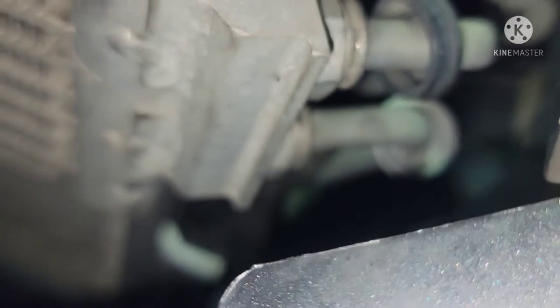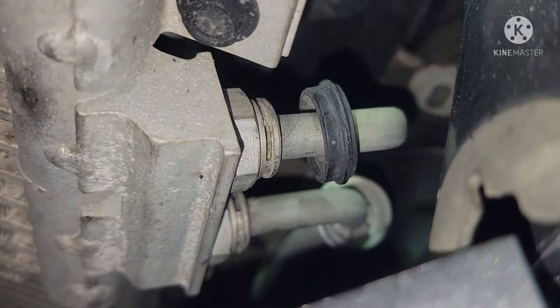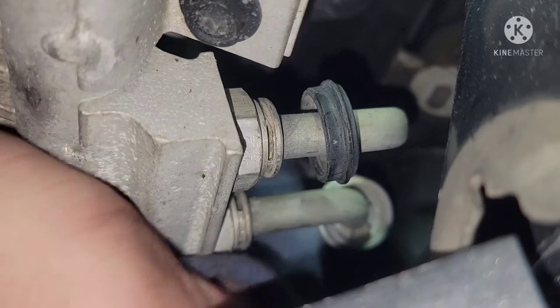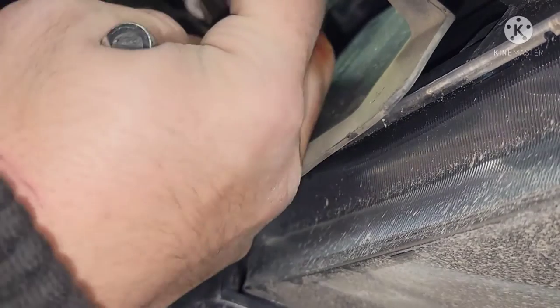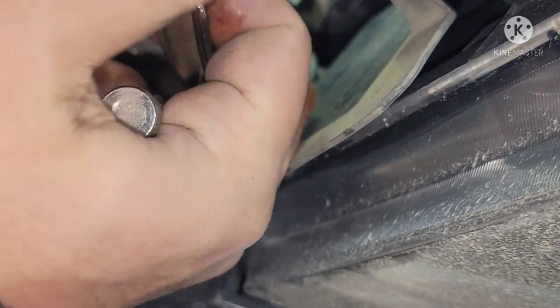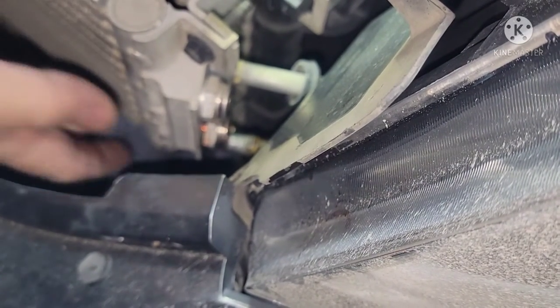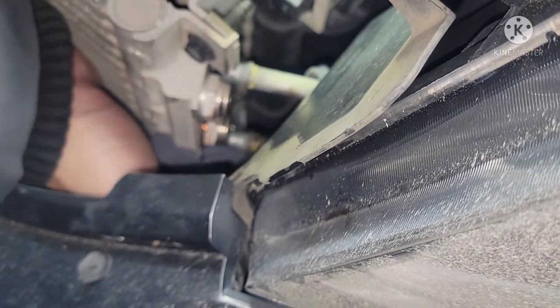It's out, guys. All right, so popping this hose is gonna be a big mess, so get a rag ready, shove it underneath. All right, so we're just gonna clamp the hose and then we'll push it out, because there's no grip on this hose at all. There's no grip pulling it out. So there you go, both lines are off the cooler. I'll keep that rag down there.